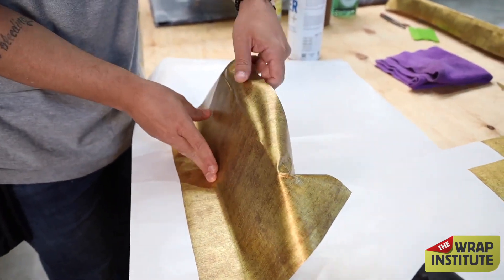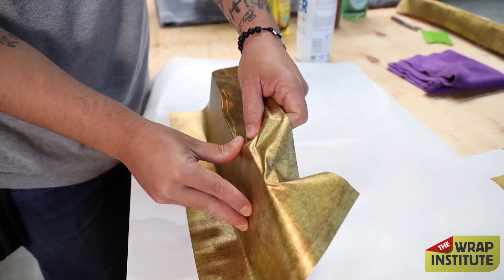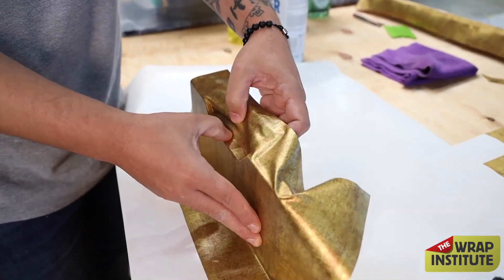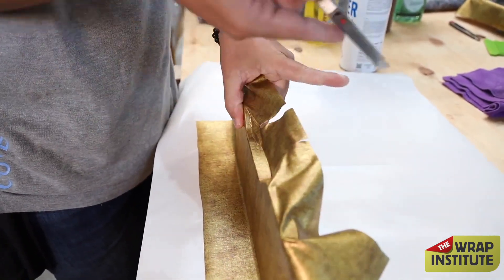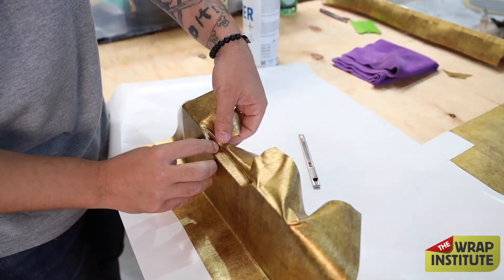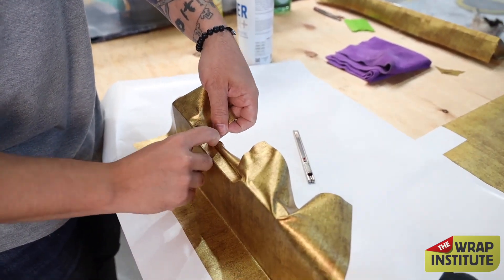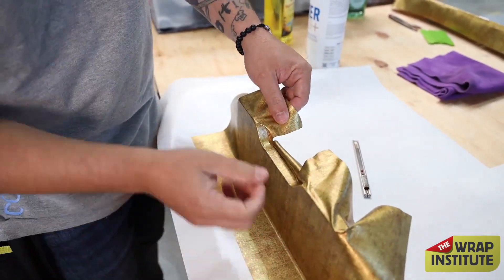This particular material he's working with is cover style — it's around 10 mil thick and has a bit of a texture to it, so it doesn't like to stretch too much. GMS wants to wrap the top section, which is the most visual, in one piece, so he feeds the mouth first with heat and then relaxes the film. By doing that, the material builds up a little bit of tension right on that upper body line, so he gives it a kiss of heat.